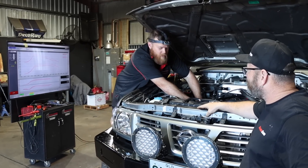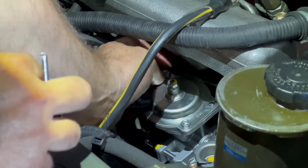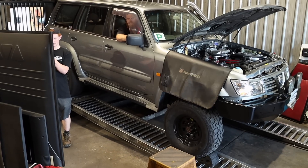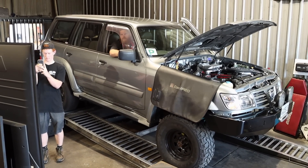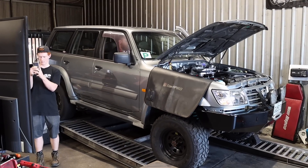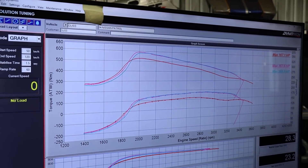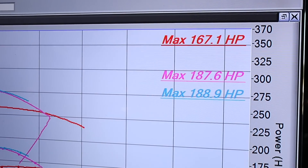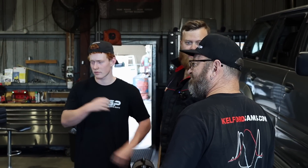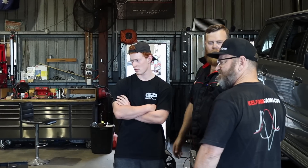Naturally again, because there's no wastegate, we don't have a way of controlling boost besides literally using fuel. So if we add more fuel now and it goes to 30-plus, we'd have to pull the fuel out — slow the turbo down and get rid of that drive energy. That's it — we can't give any more, the pump's maxed out. That's about right — you'd be expecting around 180 and that's right in the ballpark. So we can put those shims back in to where it was, then we'll play around with timing and see how it responds.